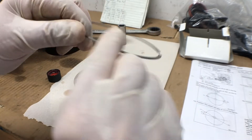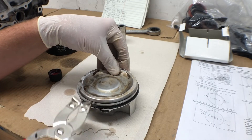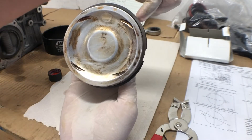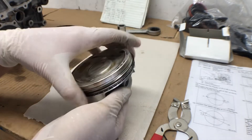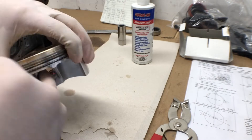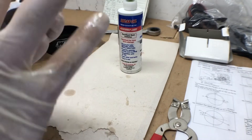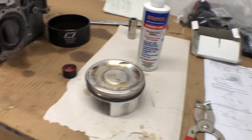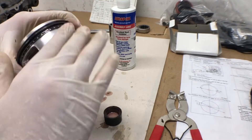The top ring is the shiny one — the compression ring. Here we go on the top ring; I tried to grab it halfway down so maybe it'll fit on better. So our piston is assembled with rings: top ring gap, second ring gap, top oil ring gap. I believe the oil expander ring gap is down here, and then the bottom oil rail end — the little flimsy one with the tab hanging down. I'm going to put a little bit of assembly lube inside here. I think we're ready to go; we are going to load up some Marvel Mystery Oil on the skirts and inside the piston bore area.